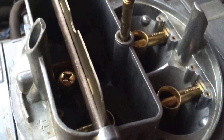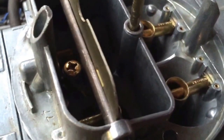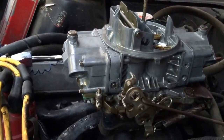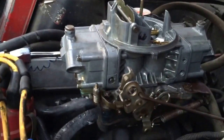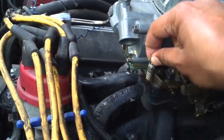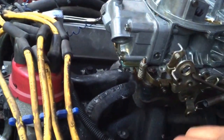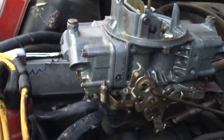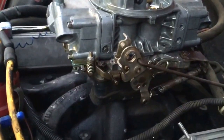There are two little jets in the accelerator pump, and when you hit the gas it sprays a jet of fuel instantly because it's a mechanical pump — giving you instantaneous fuel against that instant vacuum sucking in more air. That only lasts a second, then your main jets take over. There's a little adjustment here — make sure you don't have any slack; it should be sitting on there with about 0.008 inches clearance. That will ensure your acceleration is nice and crisp when you're taking off.